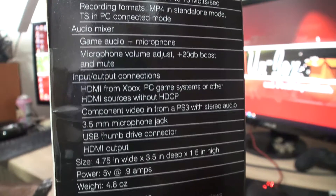Overall it's all good and working fine. Just remember to go into PS4 Settings, under System, and make sure 'Enable HDMI Device Link' is on and 'Enable HDCP' is off. When you unplug the device from the console, you'll need to switch those back — otherwise you won't be able to watch Amazon Prime or Netflix. Write it down if you have a bad memory: untick HDMI Device Link and re-tick HDCP. That's it — have fun!